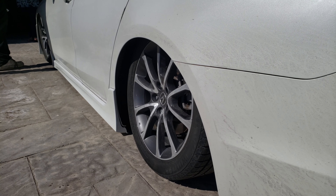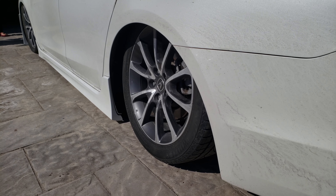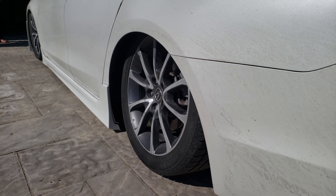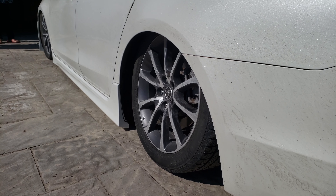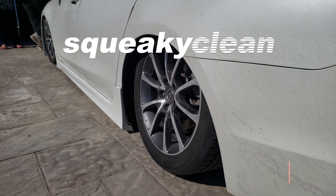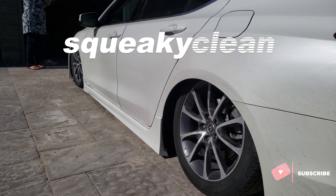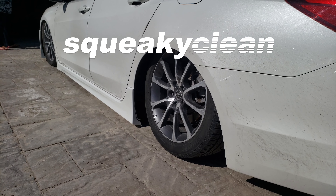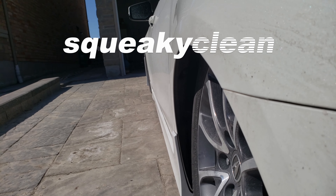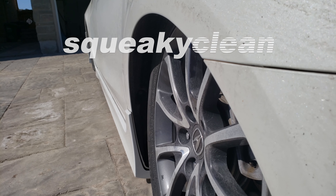So this is slammed on our air struts — it looks pretty crazy. That's one of the reasons why I always tell people to bag your car first, because if you try to go out and buy wheels to make them fit, even the most aggressive wheels you can think of, you'll still probably have a hard time with fitment. This is using the factory wheels as a base point — bag first, then do your wheel installation after. Look how much space you have to fit a wheel. Bags first, then wheels.